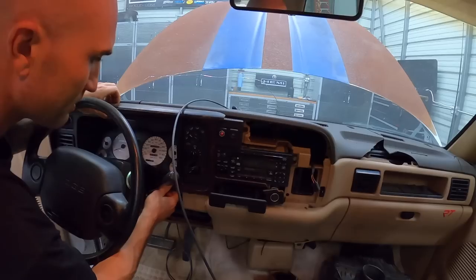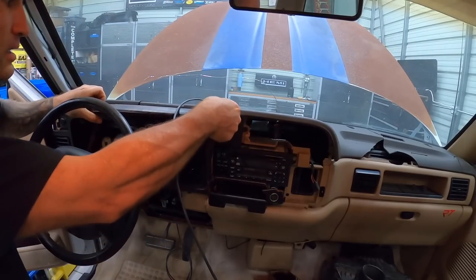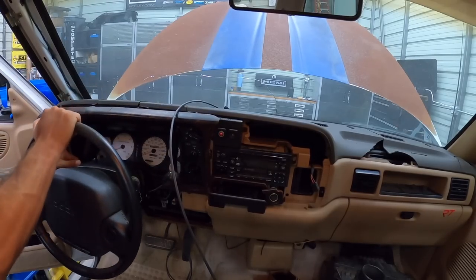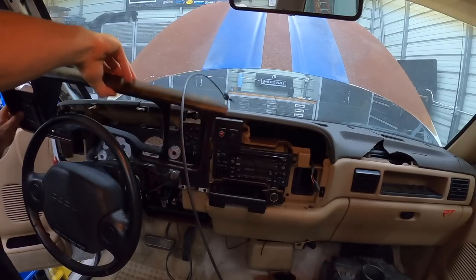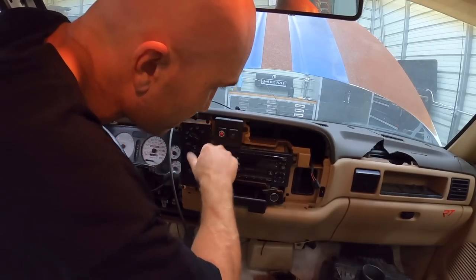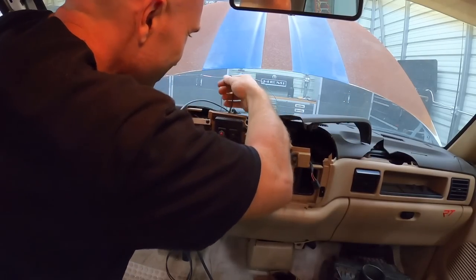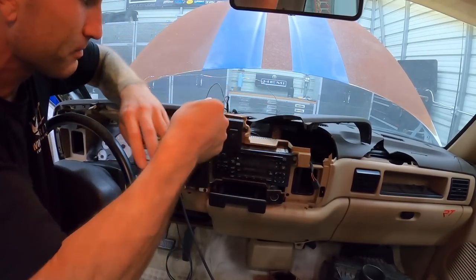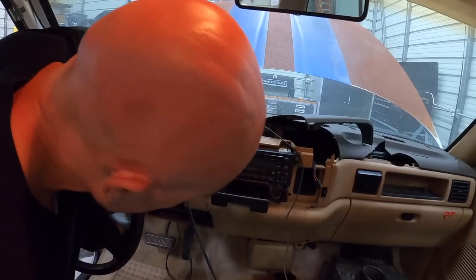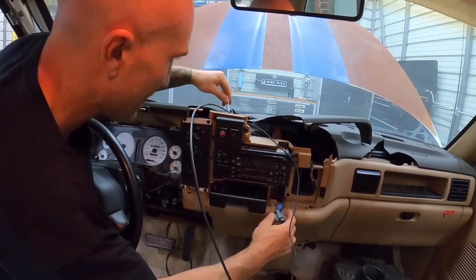I got one speed clip out — good night carambis. All right, so with two Phillips screws we should be able to get to the back of this switch. Here's our wiring for the trans brake. One side of the wire here, and this other side — it almost looks like it's wired into the cigarette lighter. And it is — they've tapped into the cigarette lighter for power.